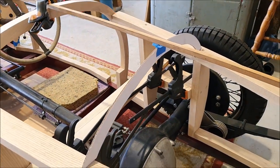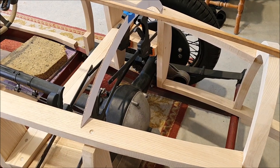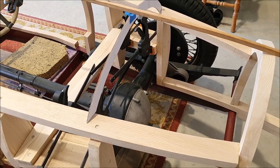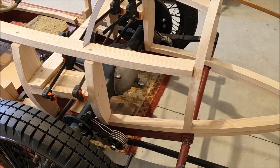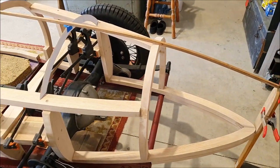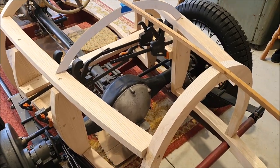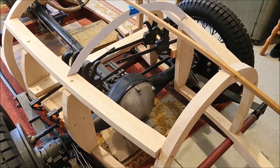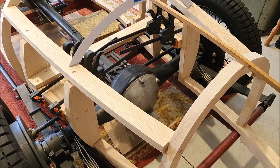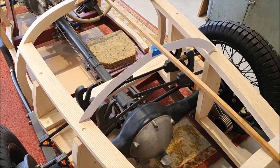Another thing I keep forgetting: I need to make the hoop that goes over the axle - that's the limit for upper travel. I think it's about an inch less than the opening, so about three inches above the axle. I still haven't finished the tail - I need to make the end piece. There'll be a vertical piece and this is the front of the boot opening. Every time I add a piece to this car it seems to get smaller, which makes sense as I'm filling up the space. You start realizing how tight these things are.